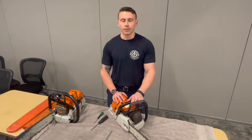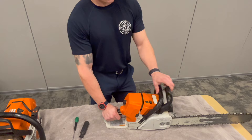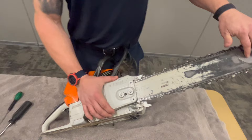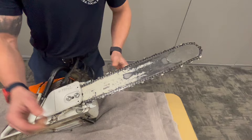This is your handle wrap — you can have one hand on the handle and the other hand down here on your trigger. This right here is your chain brake. In order for the chain to spin, your chain brake has to be off. General parts: we have our faceplate, our bar, and our chain. A lot of people call this a blade — these are chainsaws, so it's a chainsaw bar and chain.